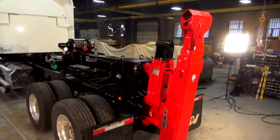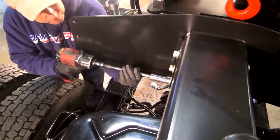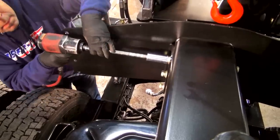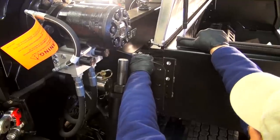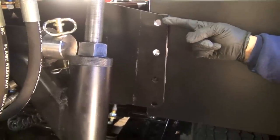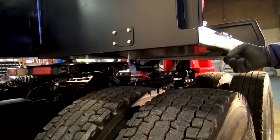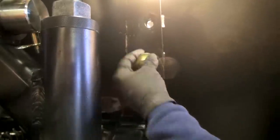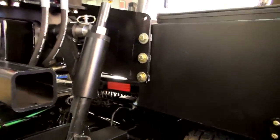Now that we have our ZAK-Lift securely in place, we're ready to move on to the installation of toolboxes — these are an optional feature. We first start by loosening up the saddle clamp and then positioning our toolboxes. The saddle clamp has four bolt holes; the toolbox has three, which allows for height adjustment. Make sure you have plenty of height between the bottom of your toolboxes and the top of the tires — this will help when adding fenders. If you live in a climate where you'll be putting chains on your truck, make sure to have plenty of clearance between the fenders and tires.